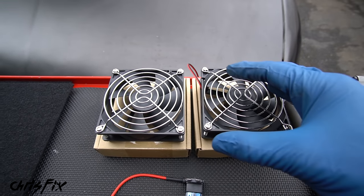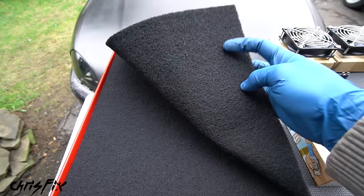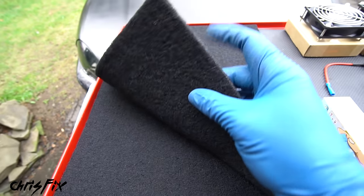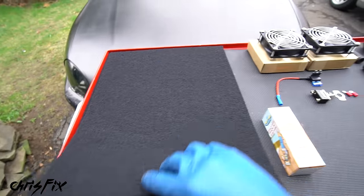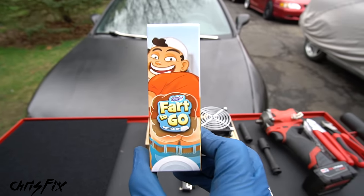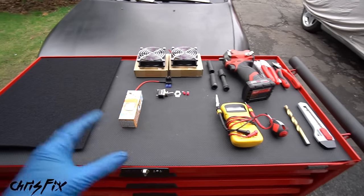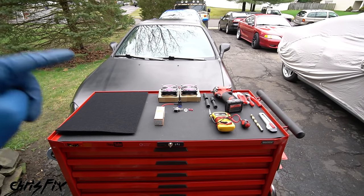A typical fart is less than one cubic foot, so it's going to take less than a second to get it all filtered through our filter material. This is a charcoal filter — what you'd find in an air purifier. It absorbs odors via chemical attraction; the surface area of activated charcoal is insanely high, so it's going to pull out the hydrogen sulfide and methane that give farts their bad smell. We also have a fuse tap, a switch, and at the end of the video I have fart spray to prove this works. I'll link all materials in the description.